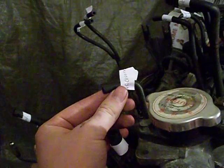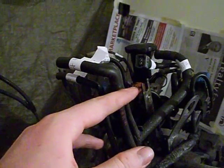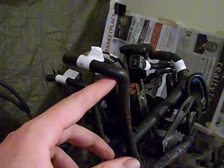The fuel injector harness — we've got two here. We've got the fuel line, another fuel line, and the fuel vacuum hose. Then there are three vacuum hoses that go to the front of the intake manifold. They're labeled top, medium, and bottom for the position from the top.